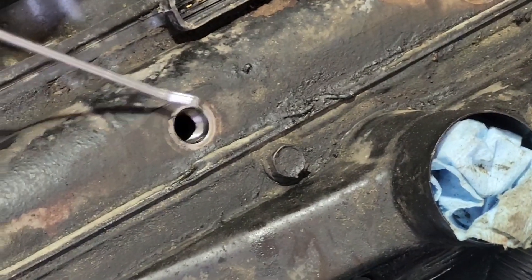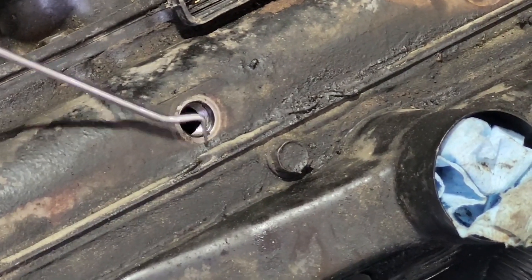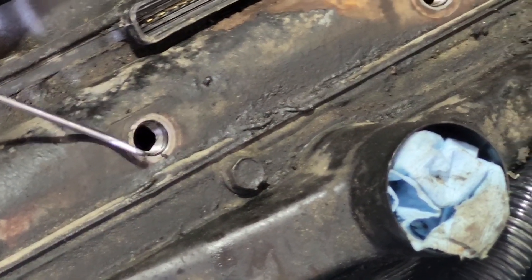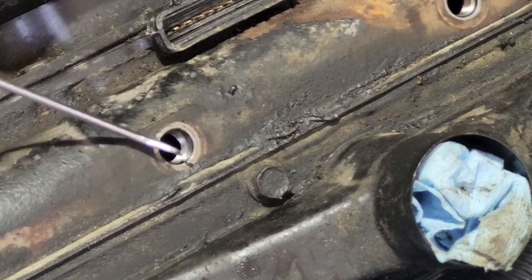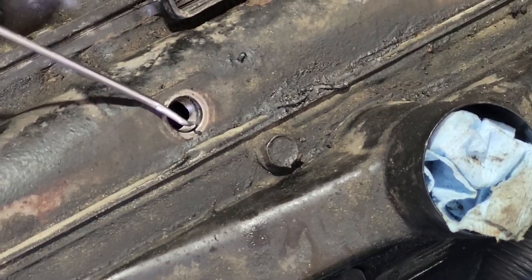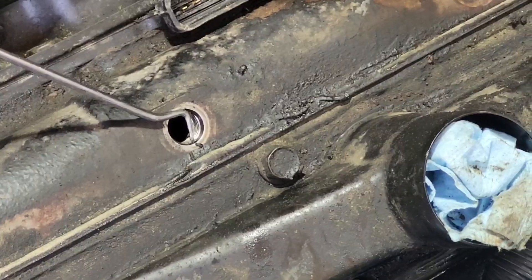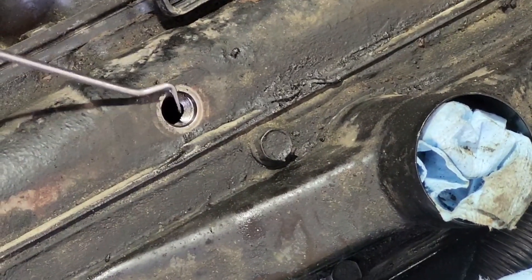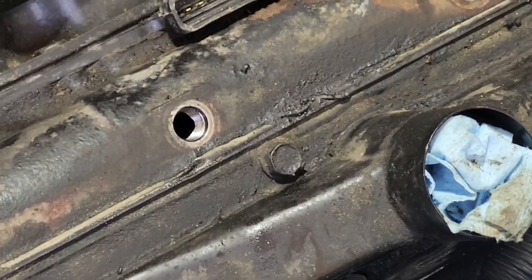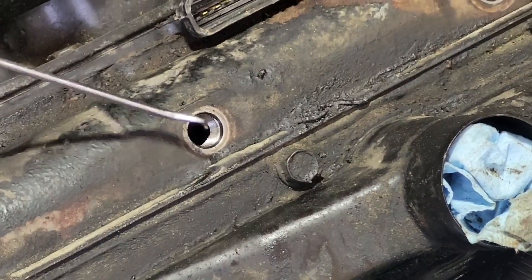This one I haven't cleaned out yet, so I want to show you what I mean by cleaning out the threads. You can see there's some old Loctite in there — you want to get that out. It's just like when you do injector cups: if you don't get the old Loctite out, you have an uneven sealing surface, and this is where the O-ring sits. This has got to hold back like 3,000 PSI — it's no joke. So you've got to get the old Loctite and any old O-ring material out of there and make sure it's all nice and clean.